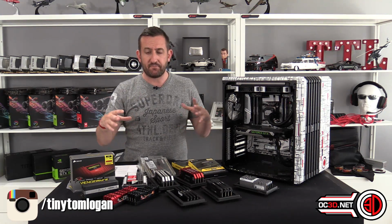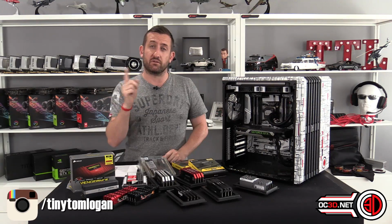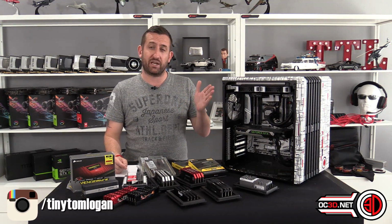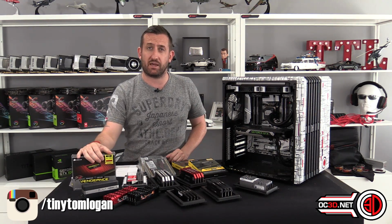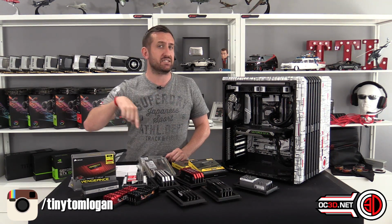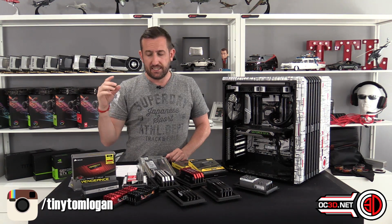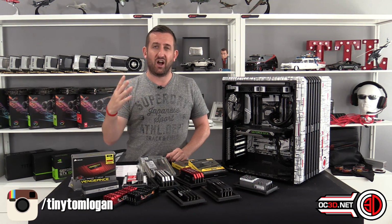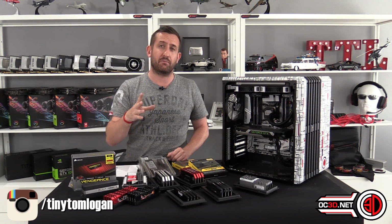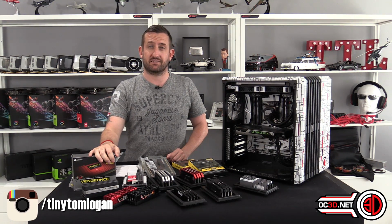Because I was then trying, I thought to myself, right, okay, so we can't find what it is. I'm going to back the voltages off. I'm going to drop the clock back. So we ended up going at 1.3 volts for 4.3 with the 3200 megahertz memory. We were still getting absolute, like, instantaneous spikes with the temperatures. So then I thought to myself, I'll give it a chance, we'll see how far it would go. So I put the OCCT limit up to 90 degrees, and then it was doing that within 4 minutes.